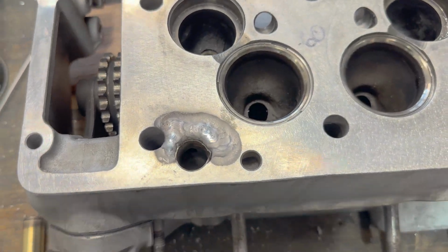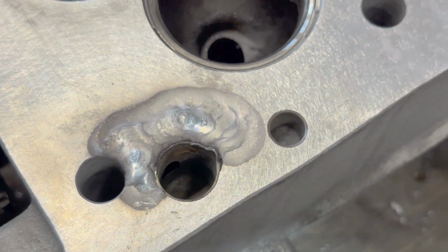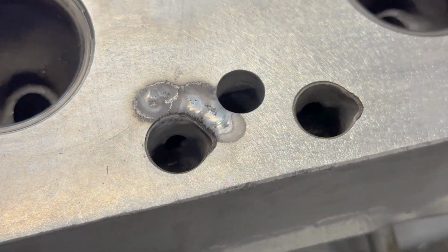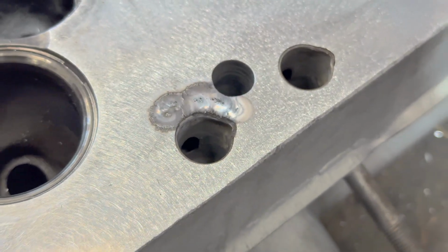Ooh, nasty. Well, these things are nasty. Lots of holes. I'm going to peen this weld down. I just washed this area around without any filler, and it's dirty. I'm going to grind it back again and then add some metal in.